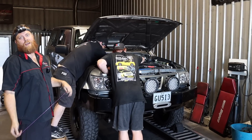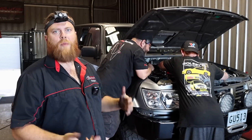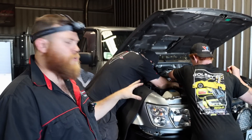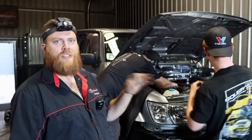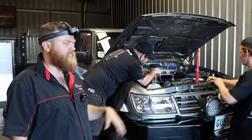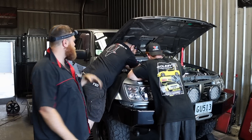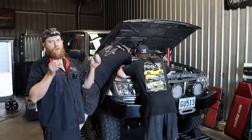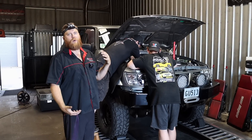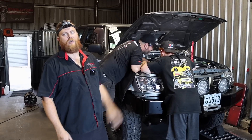We've got the apprentice cracking the pump — we're going to play around with the timing a bit. Essentially, usually if you buy a pump the pump builder will tell you what timing they want because it's their pump. But it still goes to show that every setup is different — injectors are different, compression ratios are different, how the motor and turbo interact — every combination is kind of different. So we like to just let the dyno tell us where the pump timing is happy. We've got our boost and fueling set; now we'll move the pump a little bit at a time, see how it responds. We've marked it so we know where it is and can return to it if needed.